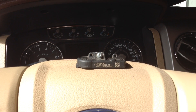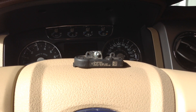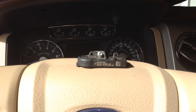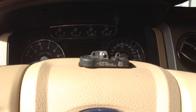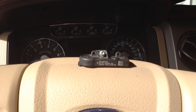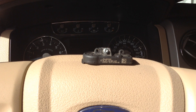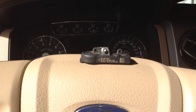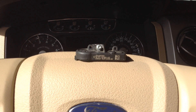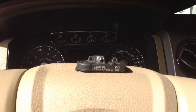On my truck the tire pressures are all 35 psi. Some heavy-duty option trucks have 65 and 55, so if you rotate the tires and put the fronts on the rear or vice versa, you can get a low tire pressure indication if you don't relearn the sensor locations. The TPMS computer could think you have low pressure because it still thinks the sensor is on the front when it's really on the rear.